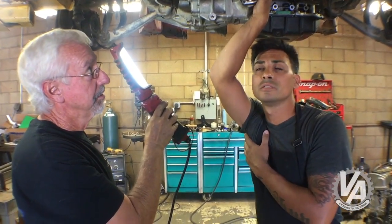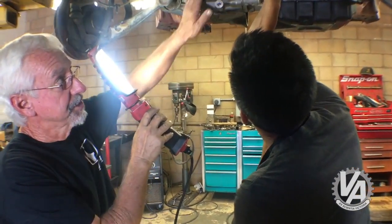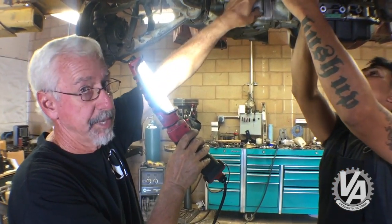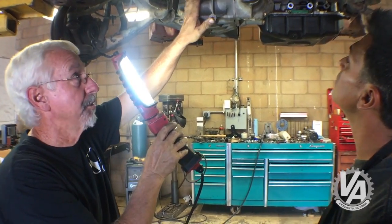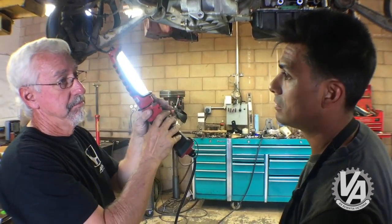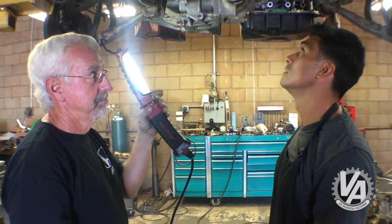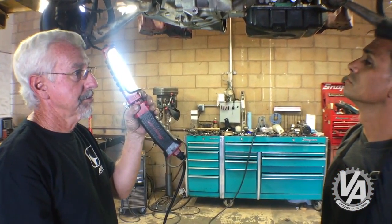If you were scared to dig into the casing, then you could dent that. But these are basically mounting bosses. This engine mounts in the CRX with a bracket that bolts to the back of the block. Now that bracket is strengthened obviously because it holds the engine — we're not going to be holding it there, we're going to be holding it up higher up on the block. So basically I can make a mount that works with Accord transmissions, TSX transmissions, 2012 Civic transmissions, and all-wheel drive transmissions. Basically it'll be the same — maybe one bracket, maybe two brackets.